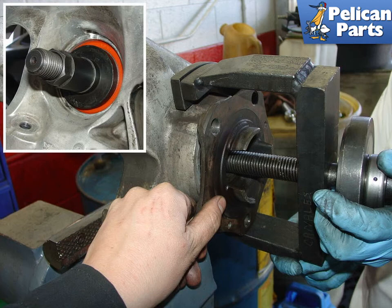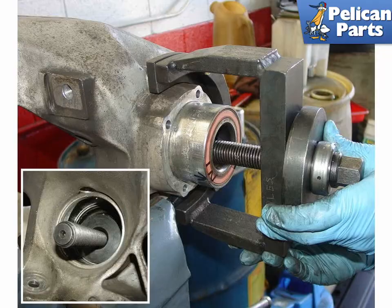In this photo, you can see part 1 of a bench demonstration of the process of pulling out a wheel hub using the tool. Put a backing plate on the inner race and use the tool to pull the hub out of the bearing — the bearing will break apart at this point. Here's part 2: with a backing plate placed at the diameter of the outer race on the back side, the tool can simply pull the rest of the bearing out of the bore using the long center screw.